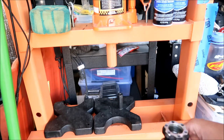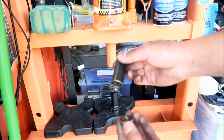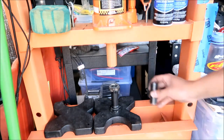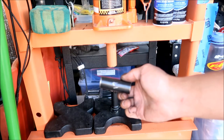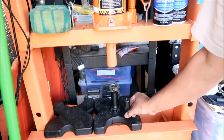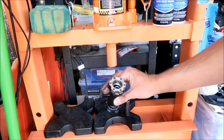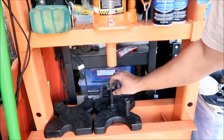Try to get the spacer centered as best you can. When putting a bearing in, make sure you press on the outer race, not the inner race, because you can damage the bearing. I'm using a 17-millimeter deep impact socket — I tried a regular socket and it was thinner and not seating very well. After you put the two bearings on one side, put the spacer in so you don't forget. It's like a wheel hub. I've got the third bearing now.